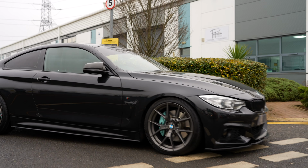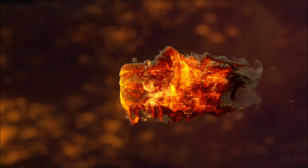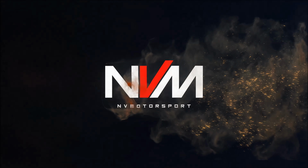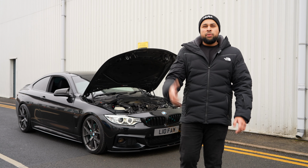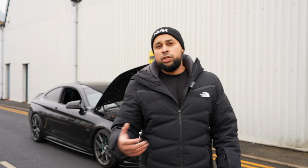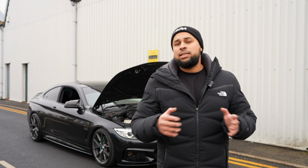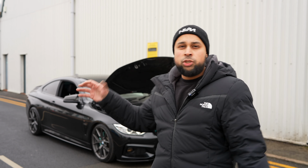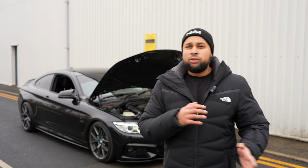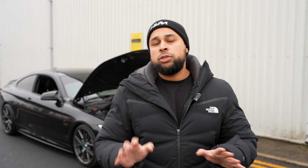Welcome back, guys, to another NVM vlog, and in this vlog we're doing some diesel tuning. This BMW 430 diesel, 2015 model, is equipped with the N57 D3 engine. It comes out of the factory with 255 brake horsepower and 560 Newton meters of torque. We have previously tuned this car NVM Stage 2, and it made about 330 brake horsepower and 650 Newton meters of torque, all on the stock turbocharger.